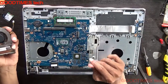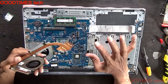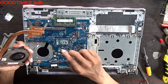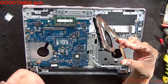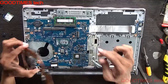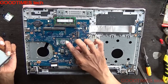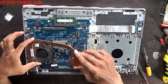After cleaning the fan and inserting again, if you are facing any overheating problem, the heat sink compound or heat sink paste will be dried up — we need to apply new heat sink paste or compound. In my case here it is not dried up, so there is no need to replace it. Before applying new paste, you need to clean it using isopropyl alcohol or PCB cleaner. Don't use a blade or any such things — they will damage the chip.